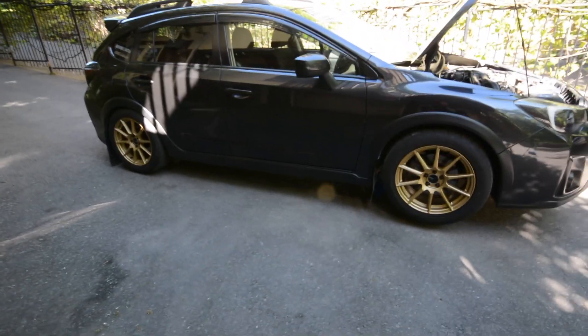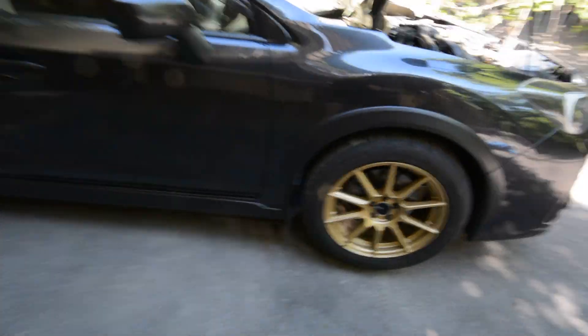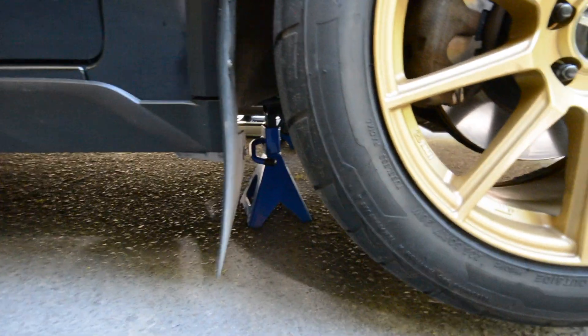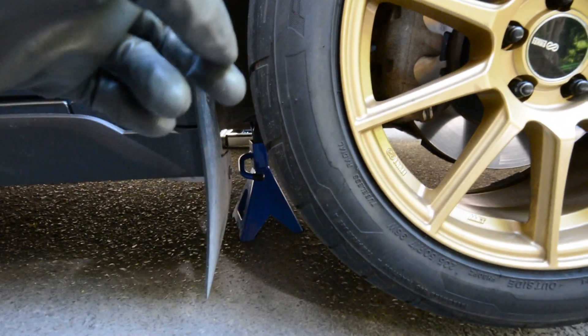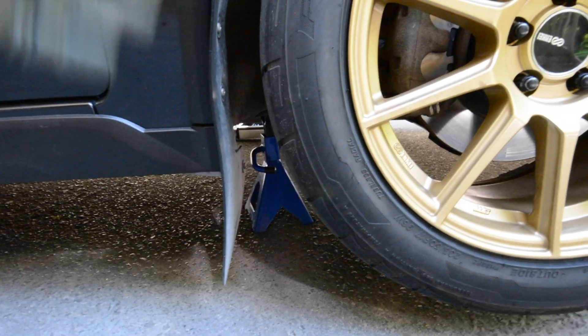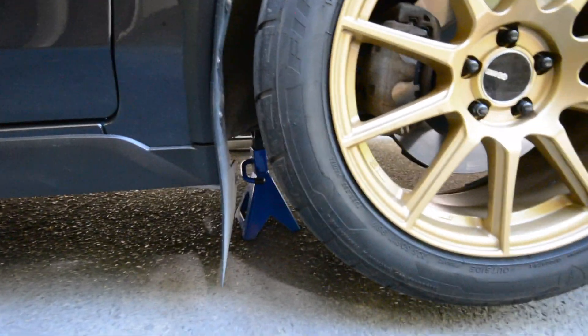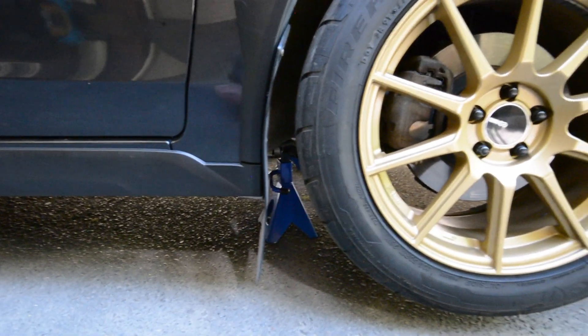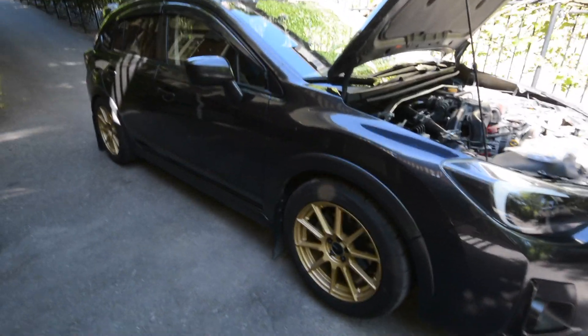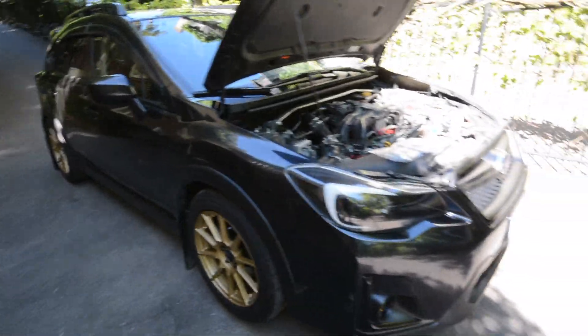Alrighty guys, the car is lifted up in the front and the rear wheels have been chocked. Thanks to Willis Doe I've been putting the jack stand kind of on where the control arm brace bolts to the subframe — that's been a really nice spot, especially when I lift from the pinch weld. My jack is quite big so it's not super easy to throw a jack in there as well. When I do the rear I go from the subframe and then do the pinch welds.